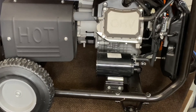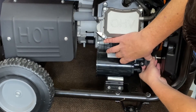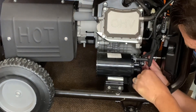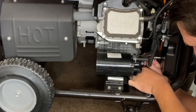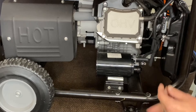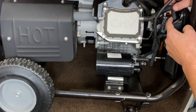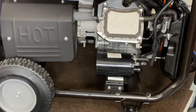Now we've got our front end done. You can kind of see the vibration bracket back there — it's tight back there but you can get to it. Go ahead and get your nut back on that and tighten it back down. Now we'll get our hoses back on — this is your gasoline vent one, get that back on, pull your clamp up. Go ahead and tuck this air breather hose back in and we are good to go on that side.